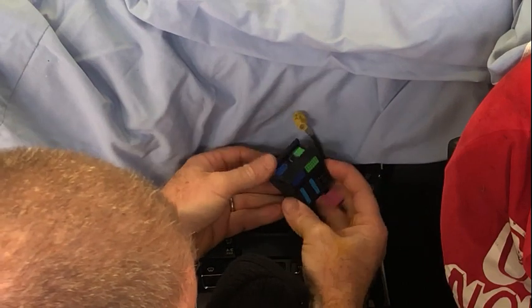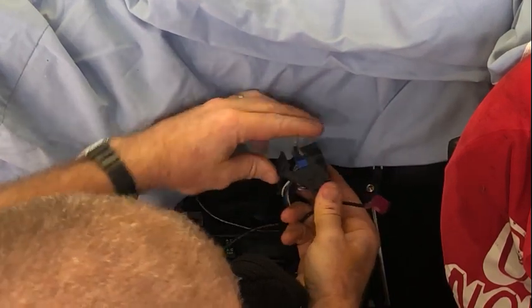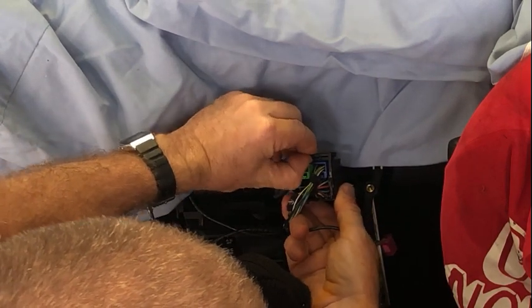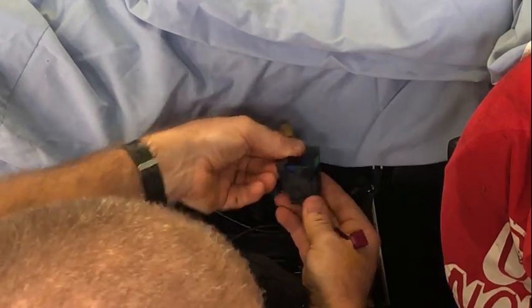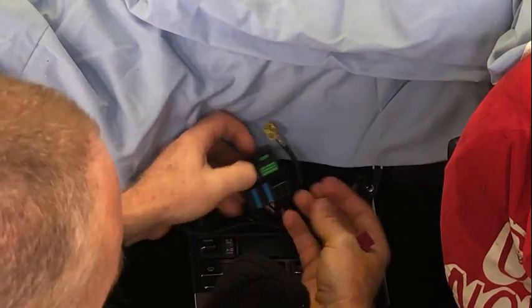There's gonna be a bunch of connectors here. There's a big one in the center. It just has a big lever. It'll be like that. You just wanna grab your finger there, lift that, and that'll just rotate and pull the whole thing out. That's really, really simple. Leave it like that for the install, and then you're just gonna plonk it in there, it'll leave it forward, and that'll just suck it into it, and lock it in place.